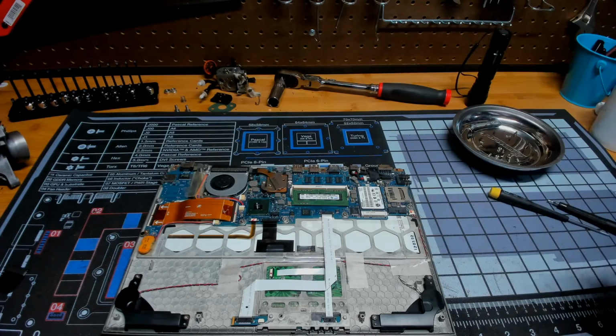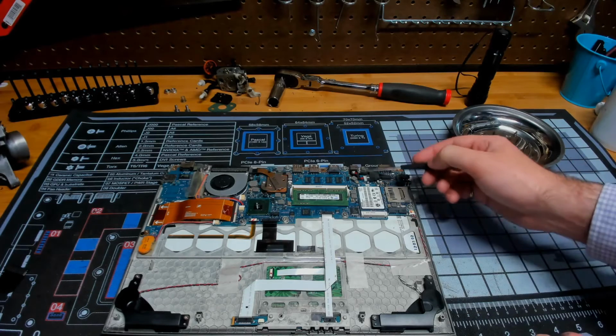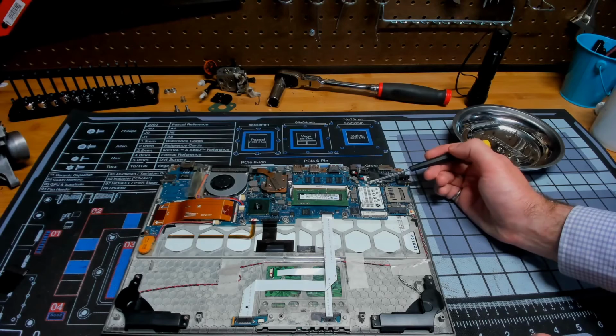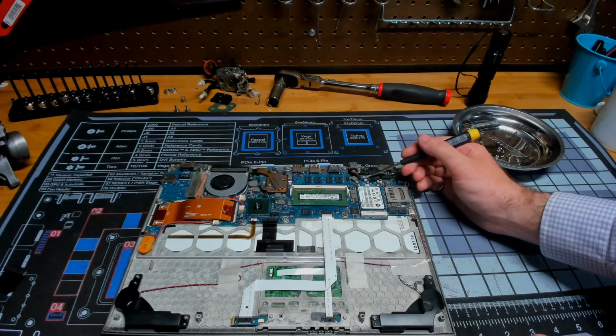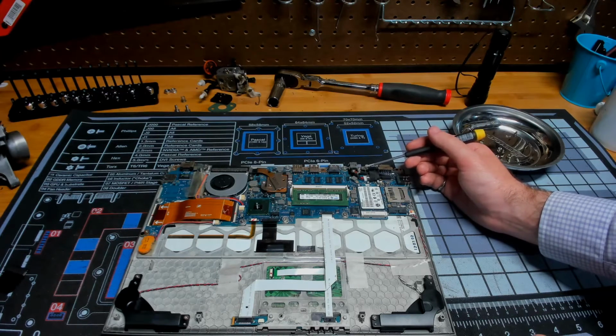Especially if you trip over your power cable or something and yank on it really hard. This can cause a lot of problems. And in fact, it is, I believe, a fairly common failure mode of laptops that the power connector just tears off of the computer. So by setting it up this way, where rather than soldering the power connector directly onto the motherboard, you run a wire between the two, all that flex is taken up by the slack in the wire. This is a non-rigid connection. It's capable of flexing, and so it can absorb all of that stress and not fatigue and break.